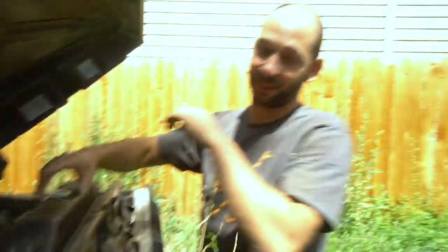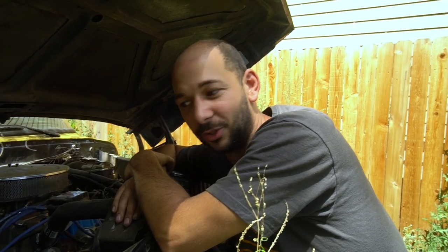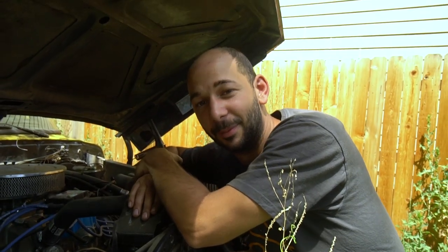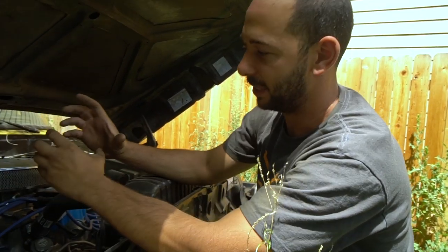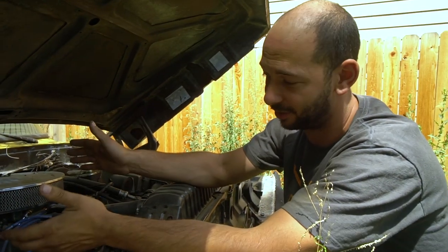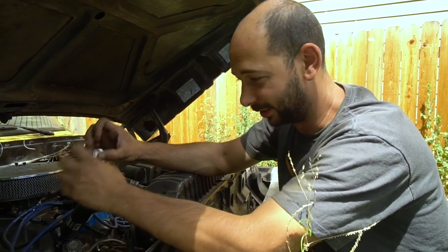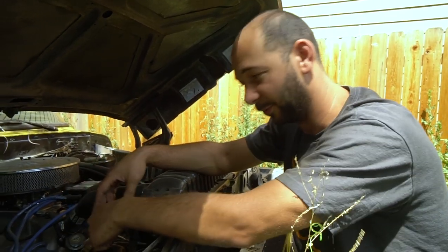She's a lot of fun, but because of that compression I couldn't get it to start. The starter didn't have enough power to turn over the engine because the compression was so high. So I ended up having to get one of these Powermaster mini starters — it's like a $500 starter. It started and the thing ran great for a week, and then it ate the flex plate because there was so much torque on the gears from the starter. It just chewed a bunch of teeth off of it.